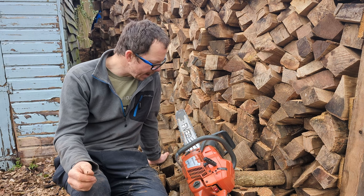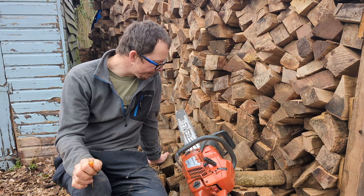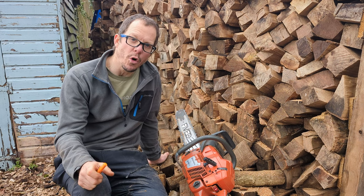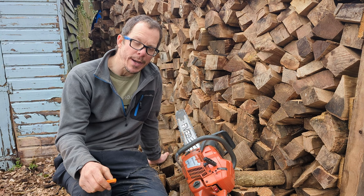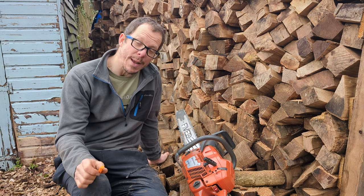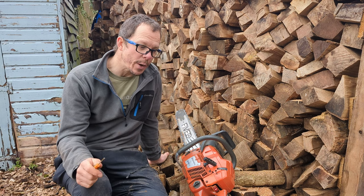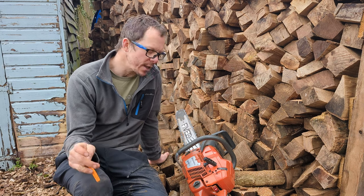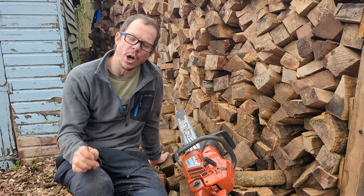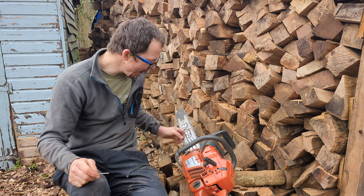Definitely seems revvier, that 15 grams lighter this piston is, remember. Definitely seems to rev more and rev fresher. So hopefully in the next tank or two, she'll bed in a little bit, and we'll see. Maybe we'll run it back against the 365, which was about 3 seconds slower in a 15-16 second cut, wasn't it? So let's see if it's got the same or faster. But anyway, yeah, fun playing.